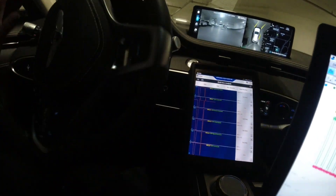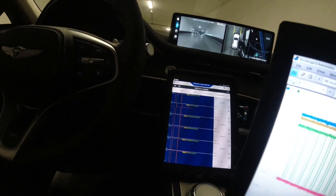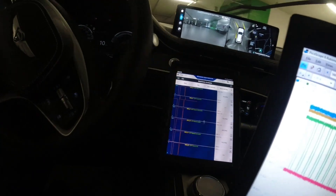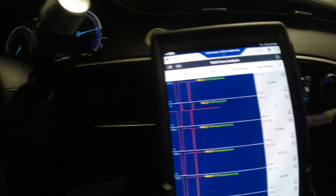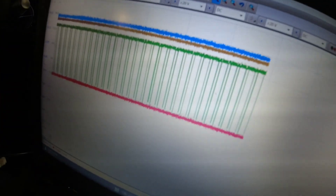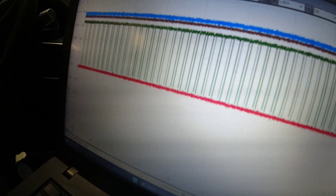I'm going to go back to the shop and then we're going to test drive this outside, make sure that warning light doesn't come back on and we don't have any codes. The front motor data should not drop to zero - because last time it goes to zero when that problem occurs. Right now the signal we have is normal: it'll be a little noisy when the pump is working, and all clean when the pump is not working.